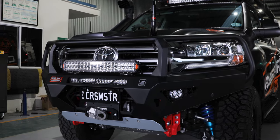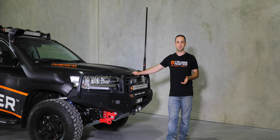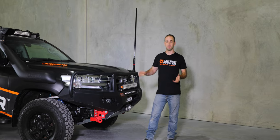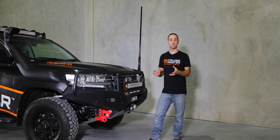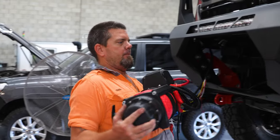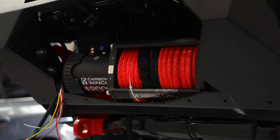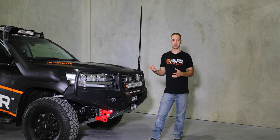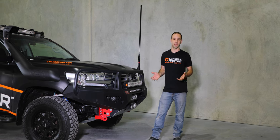Up the front of the car we put an off-road animal bar on it. One of the things we were originally concerned about was the mounting frame for the winch. Typically on the TJM bars the winch is mounted to a separate winch frame which is particularly strong, but this is mounted to the channel which has the crush zone in between it — benefit being a bit lighter, though we were concerned about the strength. When we were doing the Frenchman's Track I was towing a 2.8-ton trailer, got myself particularly well stuck and had to winch out.